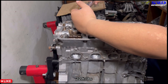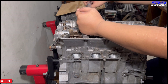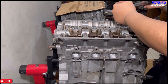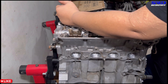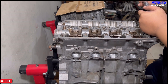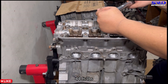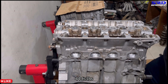Instead of going straight from 22 to 63 ft-lbs as the manual specifies, which gets hard to turn, we use a three-step sequence: 22 ft-lbs first, then 44 ft-lbs second, then 63 ft-lbs for the final step. You can do it the OEM way too — that's fine — but this multi-step approach works well for us. The second step at 44 ft-lbs is going to be louder, and that clicking sound from the torque wrench is really satisfying.